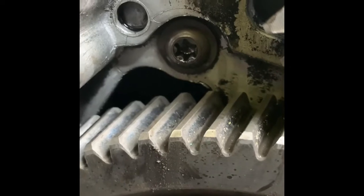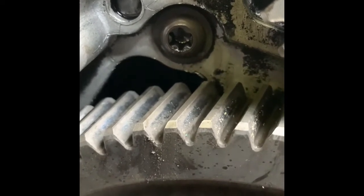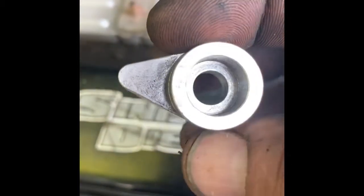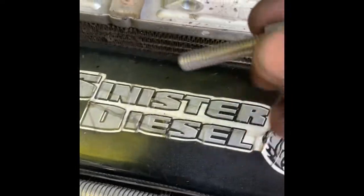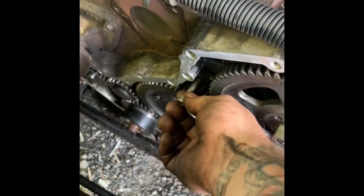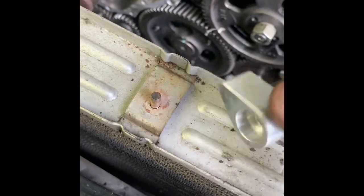There's our dowel pin. I'm going to pull that Torx out of there and install the dowel pin, a killer dowel pin adapter plate, a killer dowel pin plate. And we'll put some red thread locker on that, just so I'm not worried about it. This apparently is long enough that it won't back out far enough to come out completely with how thick this is. I think this can be used on 12 or 24 valves. So I'll do that next.